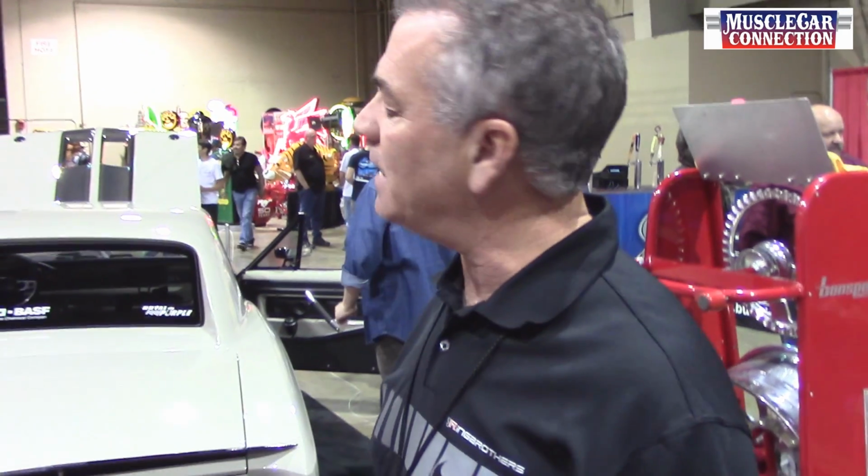Well, every time you put it on a frame, it changes. Every time it gets re-bolted, the door gaps change, which then changes the hood. You're tightening something or moving something, and everything has to be adjusted. You really got to remember every time you put one together that you have to tighten it almost the same way. But then you got to compensate for primer and paint, because once you prime and paint a hinge, and you prime and paint that door, it moves it back. Or powder coated or whatever, some kind of finish on it, it tightens the gap on the back end of the door.